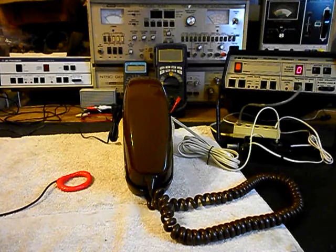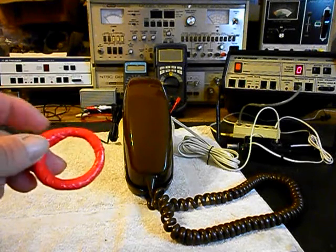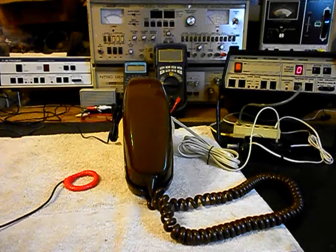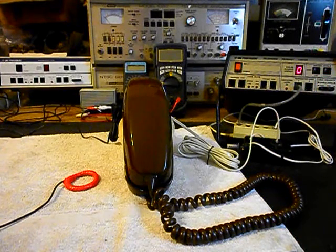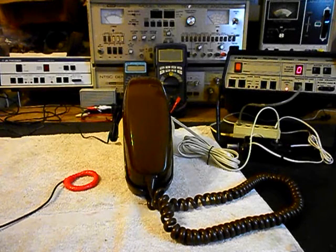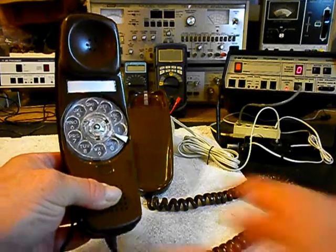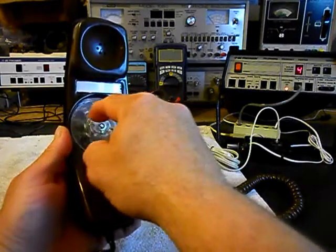We're back now and we're ready to start our final checks. We also want to mention our amplified pickup — for those who watch the videos, they know this is our amplified pickup that we use in troubleshooting, repairing, and on our final checkout. It's so that you can hear the audio from a handset when we're doing our final check. We want to go ahead and ring the unit — we're going to let that go a few times. We'll turn our amplifier on and give you some dial tone. We're going to walk through our numbers — if you watch the analyzer, you'll watch the numbers roll by. The rotary has a nice smooth return.